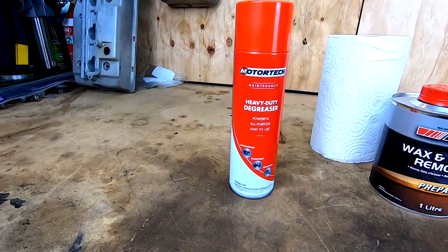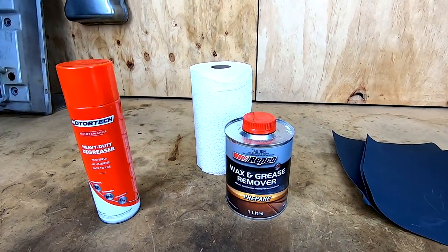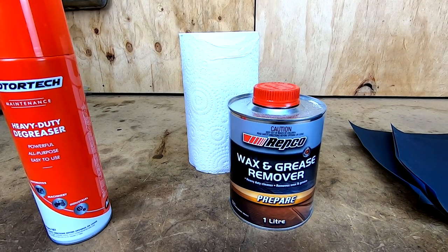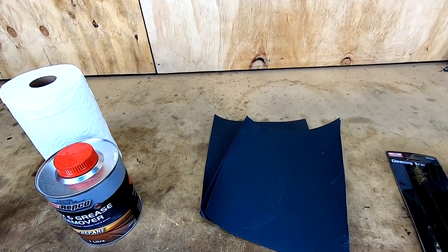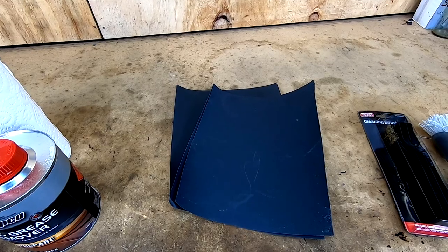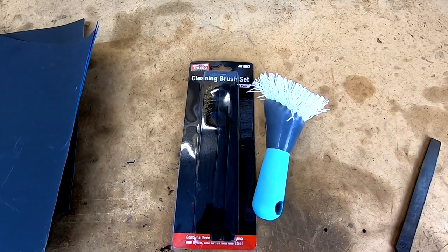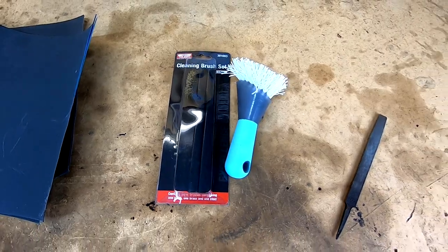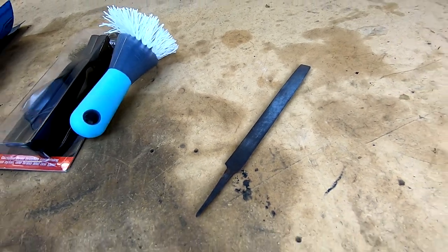So let's have a look at our supplies for this job, starting with our cleaning and prep work materials. I'll start with any old degreaser to get rid of the bulk of any contaminants. I've also got wax and grease remover and paper towels — ideally you'd use lint-free cloths, but good quality paper towels work for small jobs like this. Some sandpaper: I've got 240 and 400 grit. Scotch-brite pads may also work well if you just need to scuff up a good existing finish. I've got small brushes for hard-to-get-to spots, and a small fine-grade file to smooth out any casting imperfections.